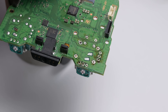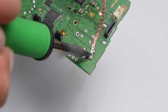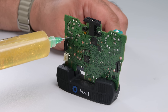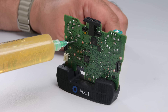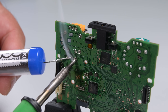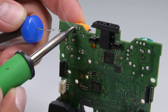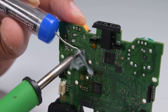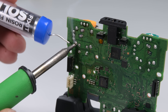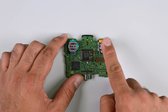After cleaning the board and removing the residual solder, it's time to install our upgrade. With the new stick module installed, I'm applying flux to the contacts I want to solder. Standing the board upright with a soldering splint worked for me, but you can change the orientation to suit your style. I want both hands free, so I'm going to apply two temporary solder points to secure the module while I work my way around. If you find your solder boiling on the iron instead of the joint, you might need to add more flux or allow the contact to heat up a bit more. And there it is — our left thumbstick is now a drift-resistant hall sensor stick.